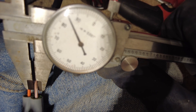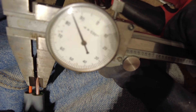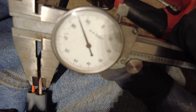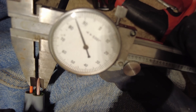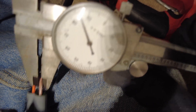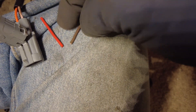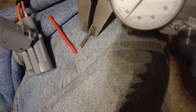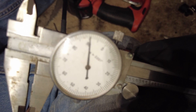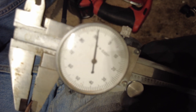I know this isn't how you normally measure or determine wire gauge, but because neither the harness nor my cheapo wiring kit are marked, I'm measuring the outside of these wires. On the harness here, this wire — the brown one, so the ground — is about 0.085 of an inch. If we take this other wire here, they're both the same size, but there's the brown one we were going to use from the kit. That comes out to just about 0.090. So technically the wire is a little bit bigger, and hopefully that means we have at least the same amount of conductors in there — it's stranded wire. I think we'll be alright.